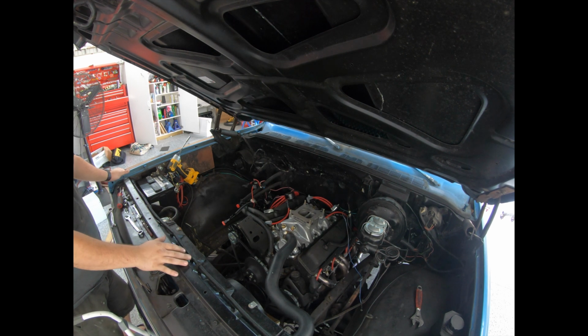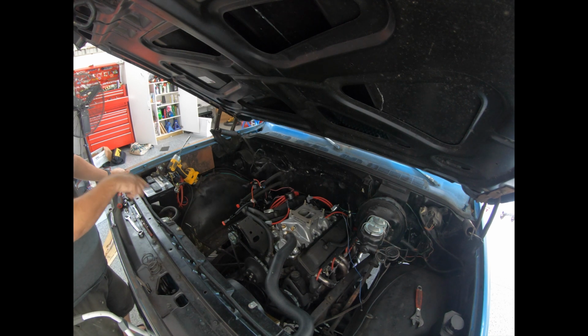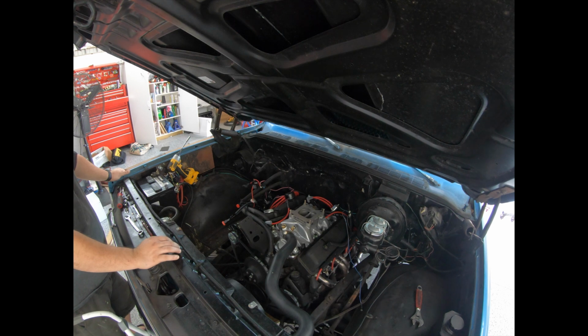But that being said, Sniper's removed. All I have left to do is pull out all this wiring and the plug wires, because those are going to go with it. On the Hyperspark you have to have a high ohm wire wrapped in copper, some kind of shielded cable, because these Snipers are bad about RFI and it will mess them up and make them not run right.